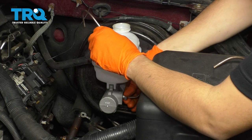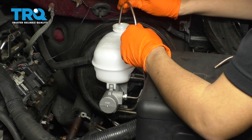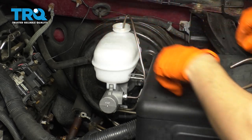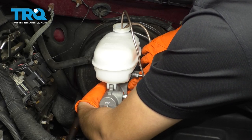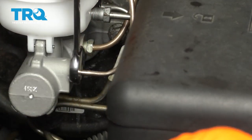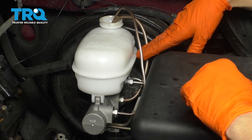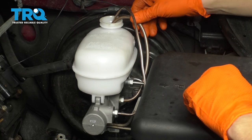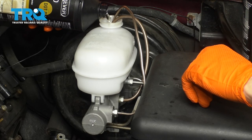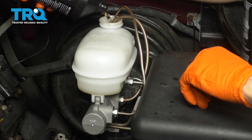There are multiple ways to bleed this. You can bleed it in a vise on the bench or you can bleed it in the car like I'm doing here. Honestly, this is the easiest way to do it, especially if you don't have anyone to help you. You can either buy a master bleeding kit, which is basically going to give you two hoses or lines that look like this, or you can make your own lines, which is what I did. Go ahead and snug these up. Make sure these lines are going as far down into the master as possible — they don't have to go all the way to the bottom, but somewhere around the middle for best results. You want to avoid sucking back air. Fill the reservoir with DOT 3 brake fluid — that's what this car takes. Fill it up to the max line, or a little bit above is fine too. Then we'll go in the car and start pumping the brakes. You will need quite a bit of brake fluid for this job, so be prepared.